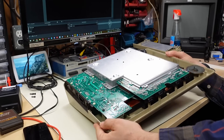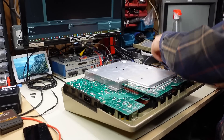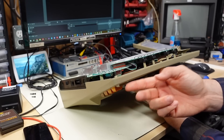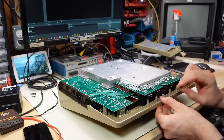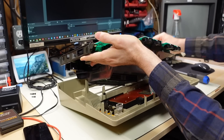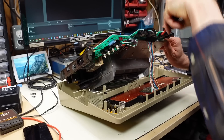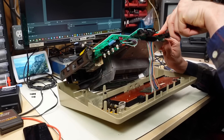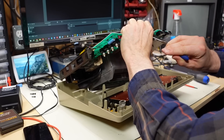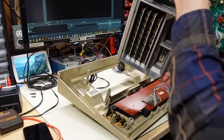This RF shield seems to have about eight screws. Once loose, I'm noticing that the keyboard under here is connected to this board, but the orange buttons on the side — the LED, the reset — are connected to this separate board over here. So they are two separate things entirely. The speaker is coming off, and the keyboard connection right here goes to this PCB where the joystick ports are. Is it even making a good connection? Yeah, I think it's on there properly — looks like it's a sort of bent type of connection. The keyboard connection is extremely stuck on here, but there it is. The computer is now free. It's unbelievably heavy.